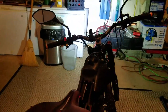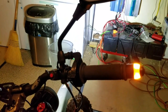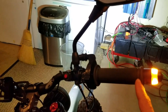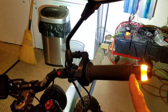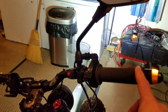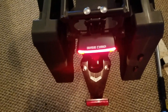On the right-hand side, tap it and it becomes a directional light as well. These wing lights screw right into the handlebar — turning the body compresses it into the bar. On both sides you need to cut the rubber grip, and on the throttle side you have to trim the throttle handle body slightly to give clearance for the shaft to come through.